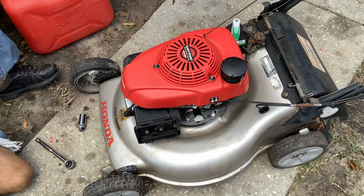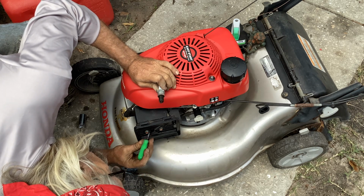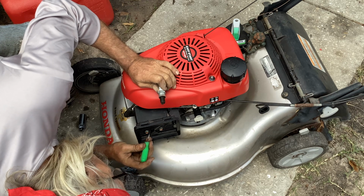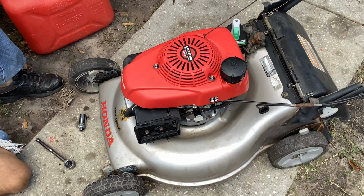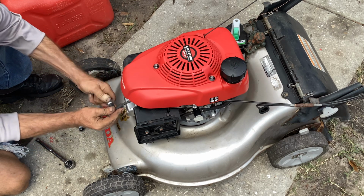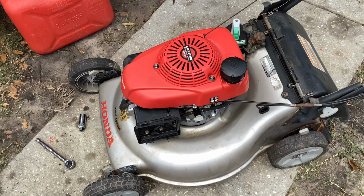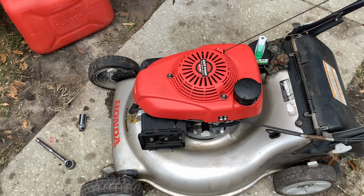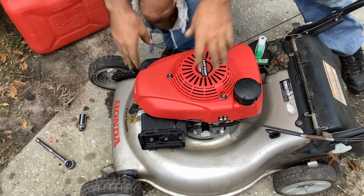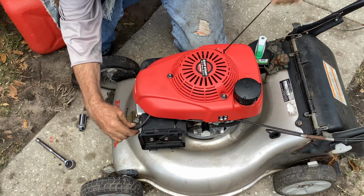I wonder if the little thermostatic choke wax thing is working. It did run for a second, and the choke lever here is closed. The wafer is closed. Maybe it didn't heat up enough. Let me put a clamp on the bail bar and then pull over this thing and see if we got some spark. Okay, how can I do this? Okay, we got spark.